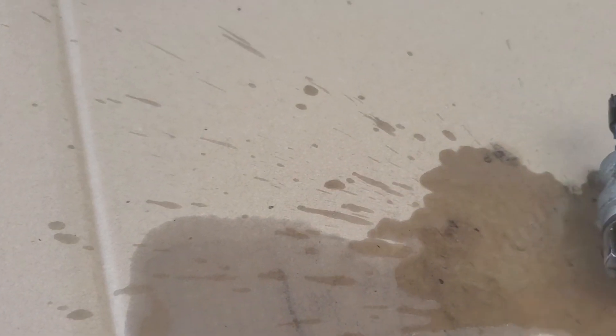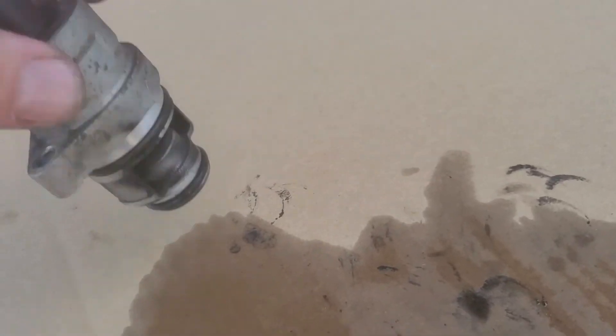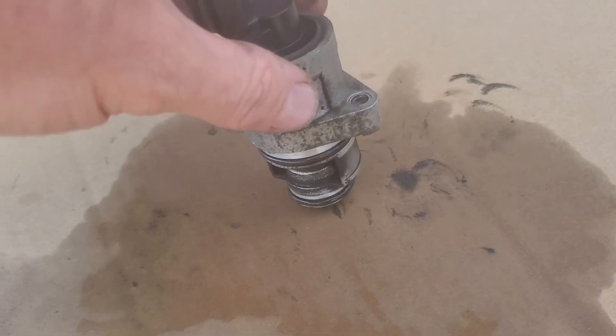Clean this thing out — you may want to replace it, but if you at least clean it out it should make a world of difference in your idle. You can see I'm getting a bunch of carbon just flaking out over there, which is great to get it out. I'll shoot it again one more time, then flip it over and shoot some up into there facing downward so no liquid goes up into the top. As you can see, there's a lot of carbon particles and little pieces that have come off, so I'll just clean this up really nice and then reinstall it.